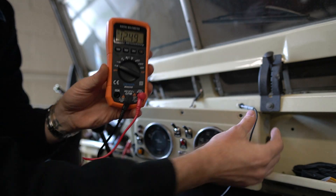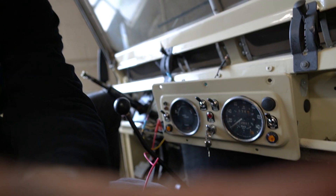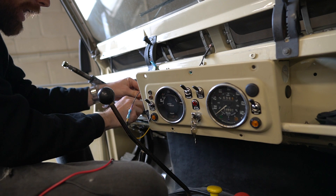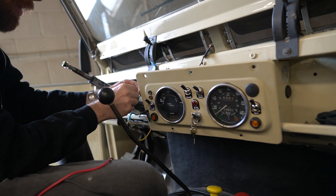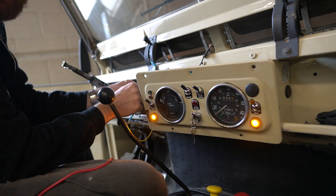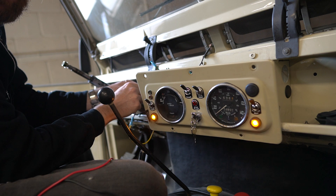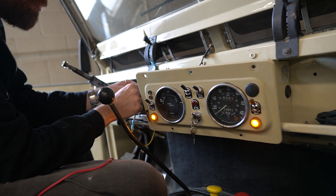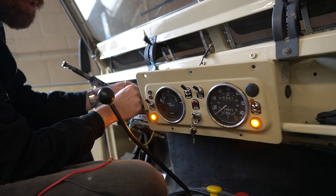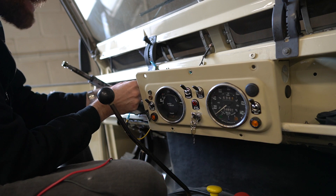In my next video, I'm going to talk about how to make sure your alternator is working, and that's where this really comes in handy. There's another way that I'll show you real quick, which I was doing quite a bit of. So this is a hot wire, and this right here is my left-right directional — actually, this is for my four-way flasher. I touch it and they're both lighting up, so that tells me very easily that I've got power. That was working in my scenario, so just tapping those two together — that's a hot wire.